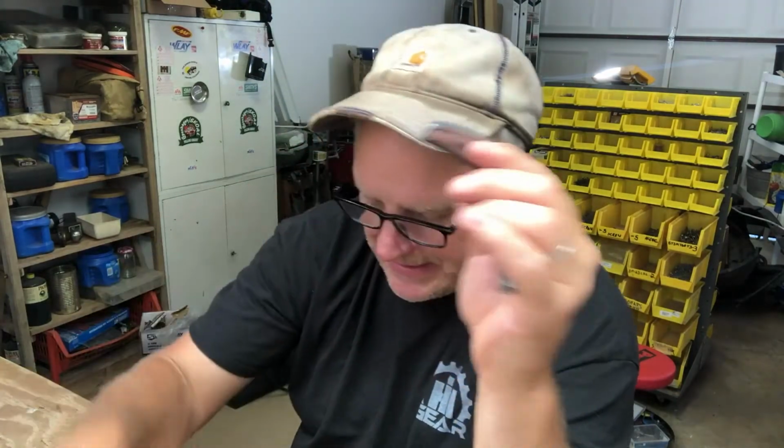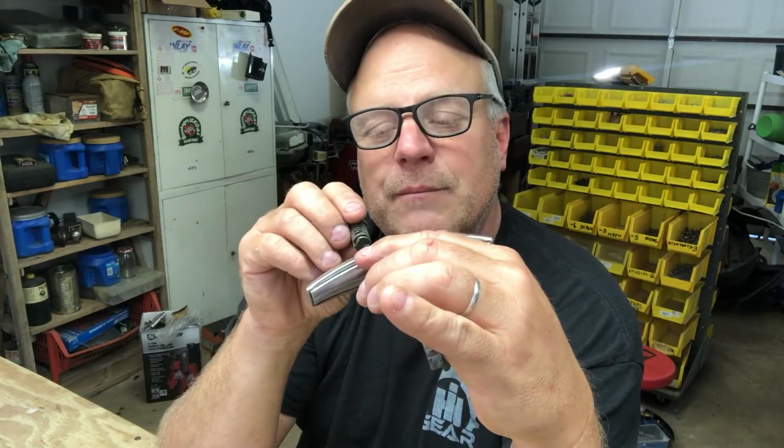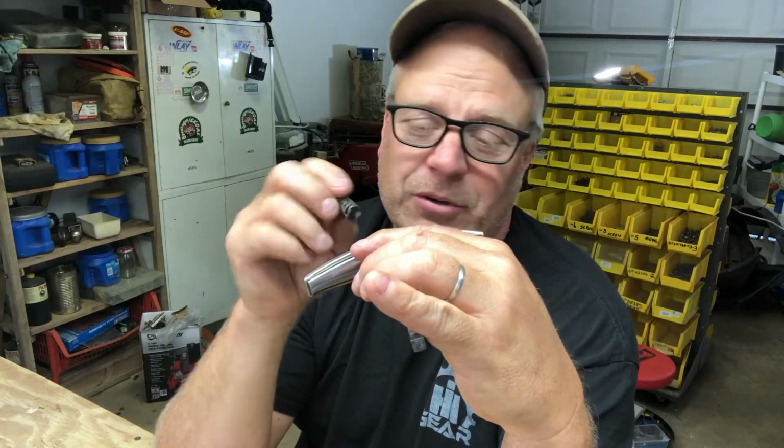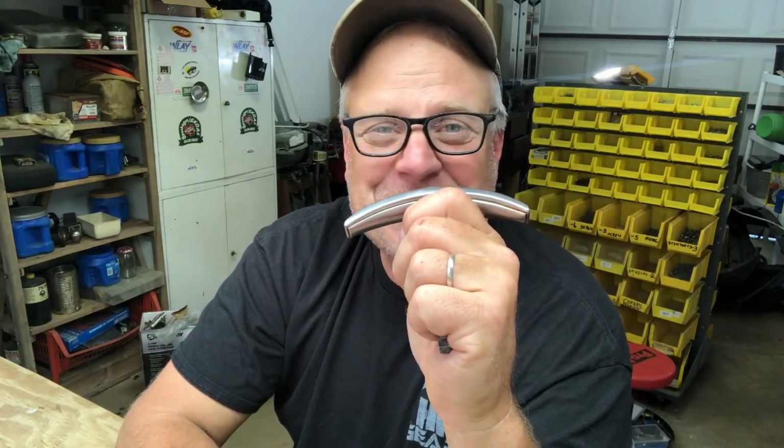Also, tip 37. When you are drilling this out, and you've cleaned out the inside really nice and you've got no more pieces, you've banged away on the thing and all the little chunks have come out, and then you take your cylinder and test fit it, you know, for your YouTube channel just to make sure it's going to work, make sure you use the cylinder that you have a key for, because when you test fit it, it's not going to come back out.